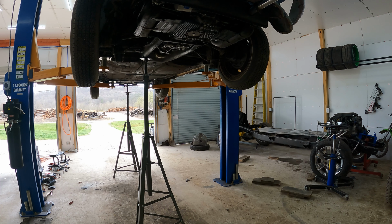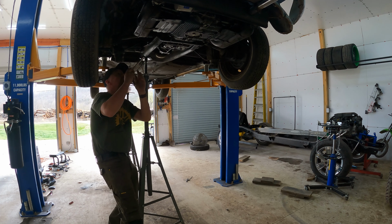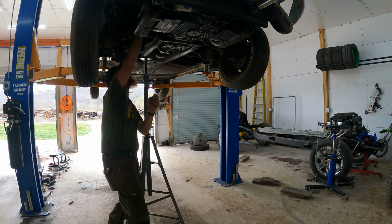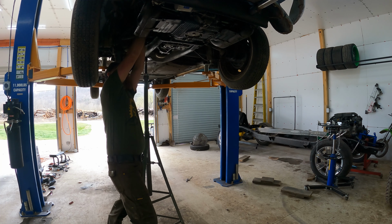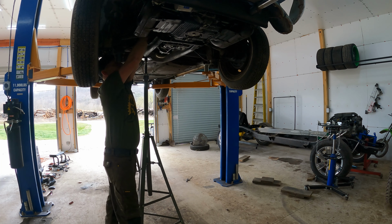So the last bolt that I always undo from underneath is the top driver's side bolt, which you do use a ratchet, a little extension to get to usually. Once I get that out, then I've got the one starter bolt still holding the motor in that I can take out from the top side when I lower the boat back down.